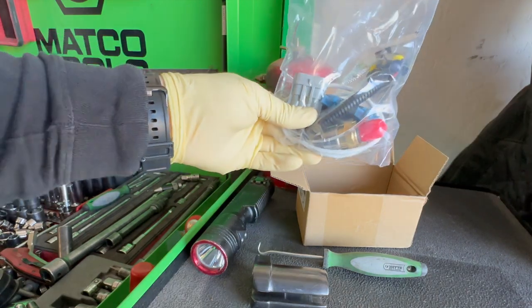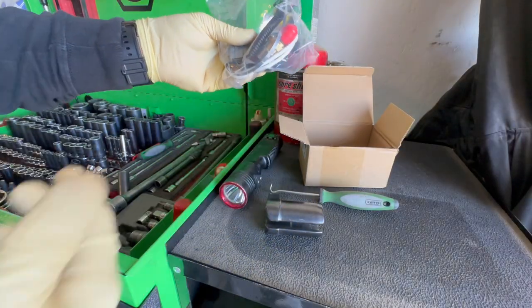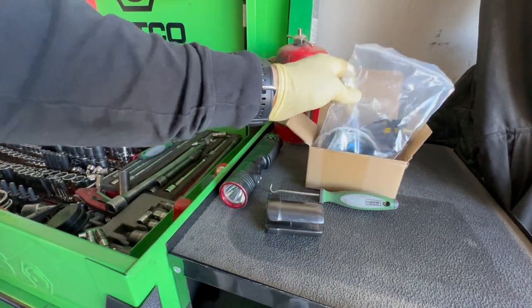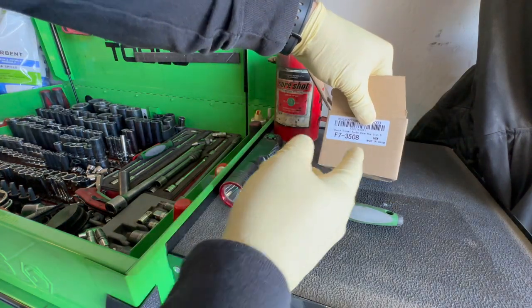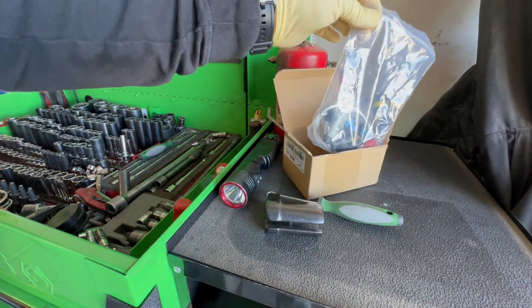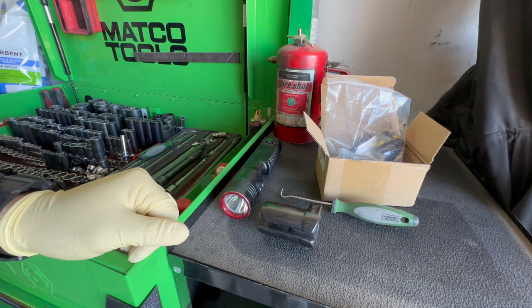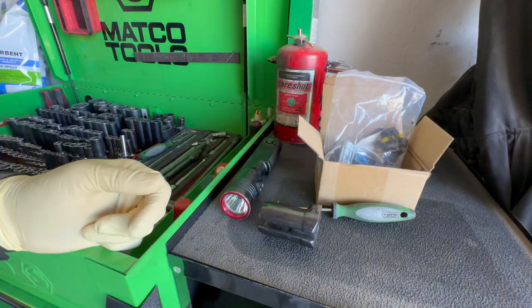We went with a cheaper Amazon turbo vane position sensor — it comes with a pigtail, a jumper, and heat tape. It's actually really nice. We don't know the QC on these, but if this fixes the truck for 40 bucks, that's awesome. Be prepared to occasionally get a bad sensor from the cheaper ones made in China, though — I mean, this clearly states 'made in China,' but where are they making the GM ones? Today we're going with the cheaper one to save several hundred dollars. You'll also need picks, flashlights, a ratchet, and an extension. I'll put links in the description below.